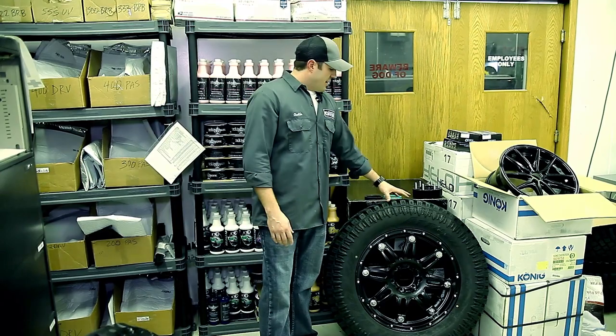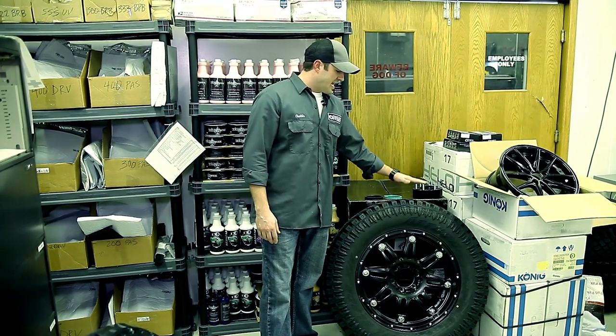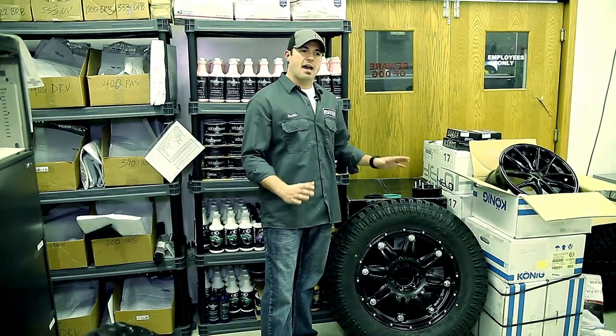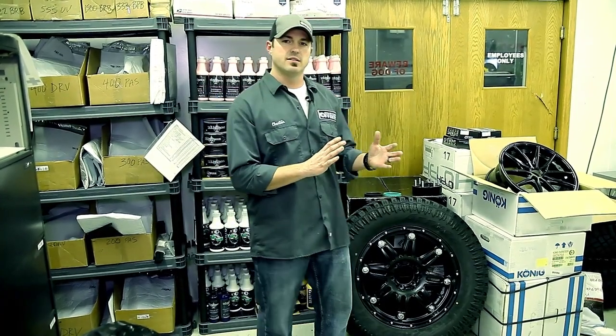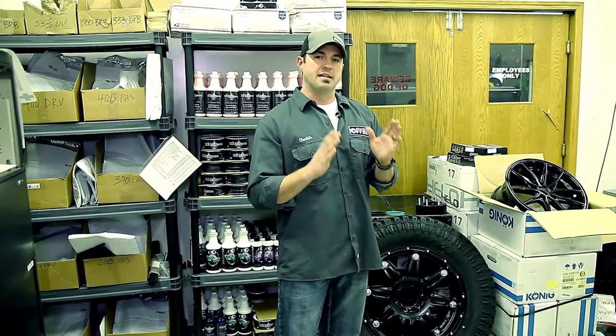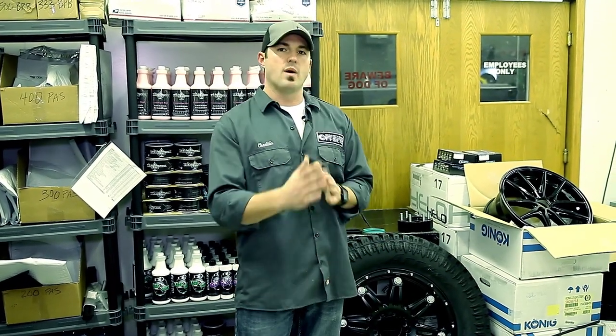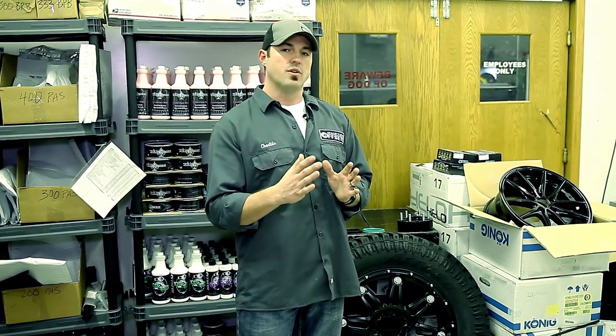The other thing — and I've run into this recently — is you may just have a wheel or tire that isn't happy with the position it's in on the vehicle. You can literally move the wheels and tires around on the vehicle and improve, reduce, or eliminate vibration. Then when you go for your next rotation, it may have had enough wear or settle-in time where it will actually stop vibrating over time.